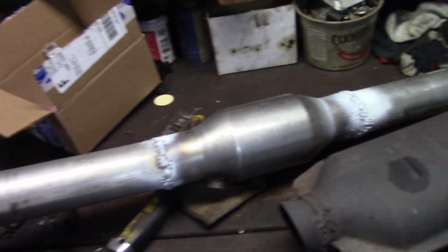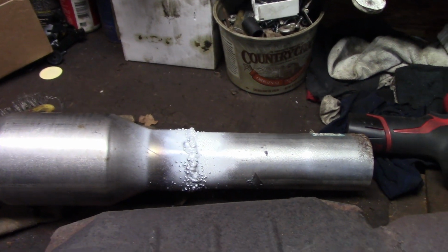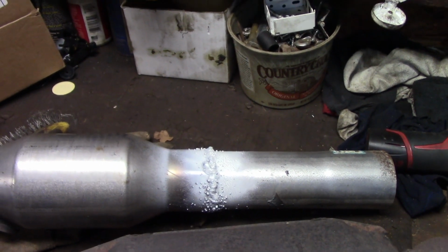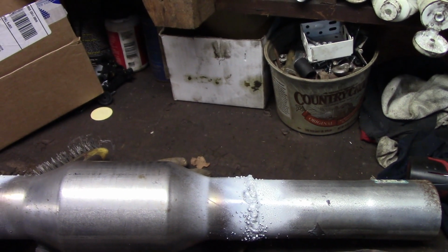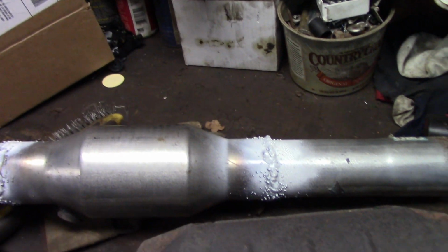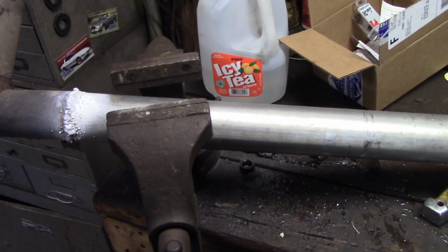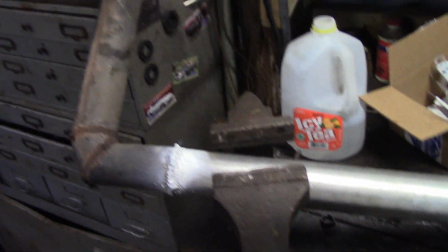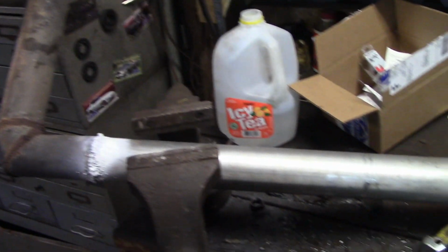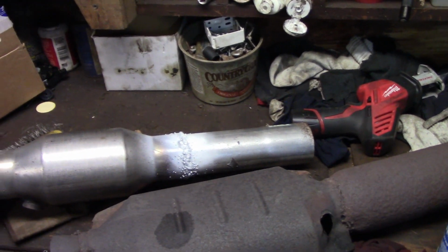So it's now all 2.5 inch. The header we put on is a 2.5 inch outlet as well, but it looks like it necks down right in the middle, right where the tranny is. Looks like it necks down at 2.25. That actually goes into the bottom of the header that I put on, but either way, here it is, and of course, once we get it on, I'll show you guys underneath and we'll fire up, see what it sounds like.